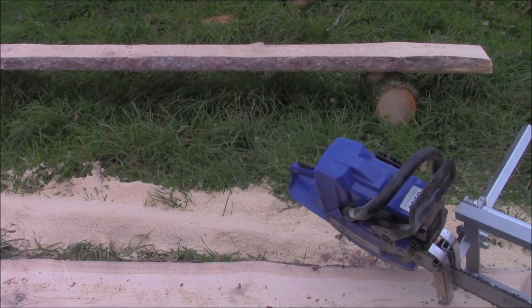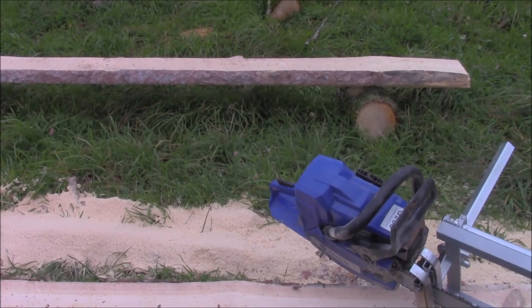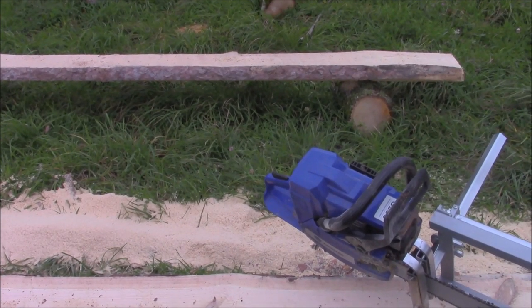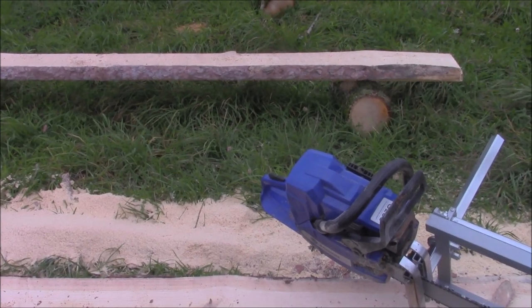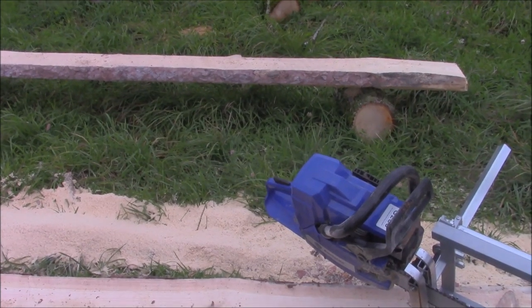But when you get into milling and things like that, or bucking, or really heavy log duty, like the guys out west who are hogging into 10-foot trees with long bars, you better have a good balance between the amount of power made, the efficiency of how that power is converted to rotational energy, and the ability for the saw to cool itself. Otherwise, you defeat the oil and the engine eventually seizes. Does that make any sense?